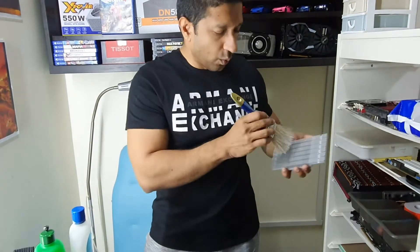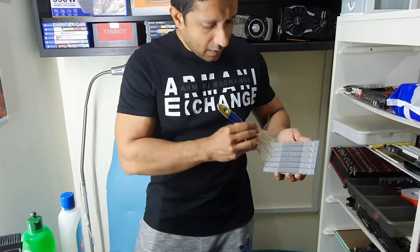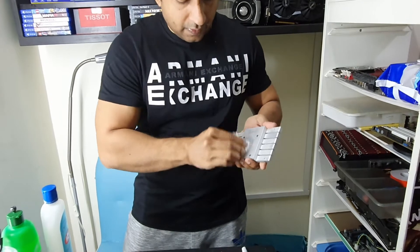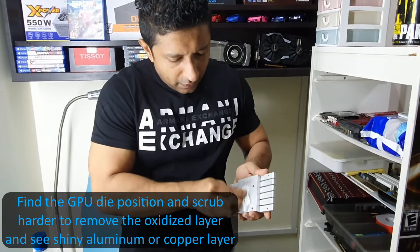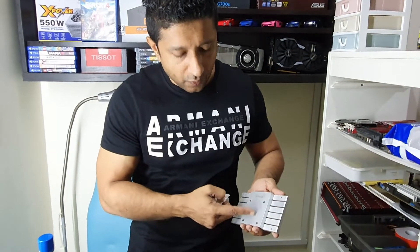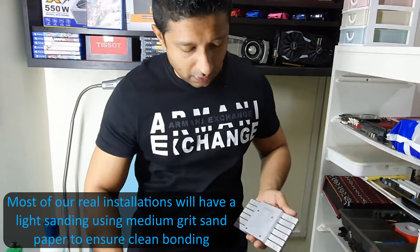Typically I wouldn't do this job here — the dusting part would be done somewhere more open so I'm not breathing in this dust and it's not falling in an awkward place. I chose these components because there is very little dust on them. I'm going to remove that thermal compound from here, because it's been there for a while I'd rather clean it thoroughly. Use a lot of pressure on it — like a scrubbing — so that over a period of time the aluminum oxidizes and forms a layer of oxidation. You need to break through that layer, then I'm going to continue with the brush.